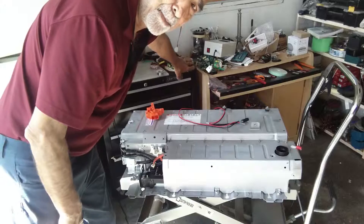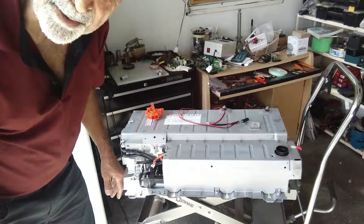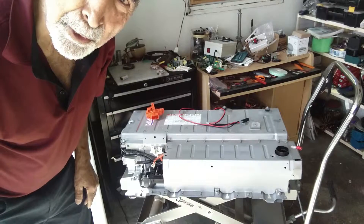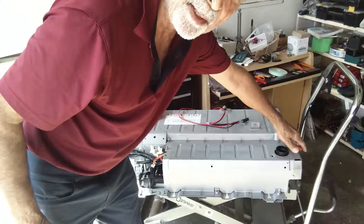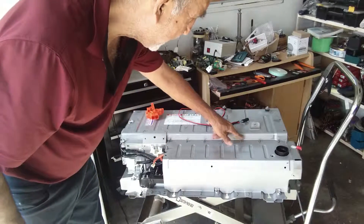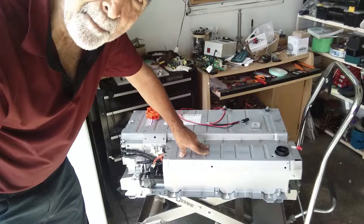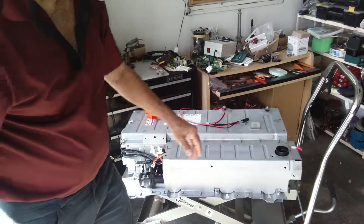On the other side, the back side is the trunk of the car. When you look at the battery inside the car, you're going to lower the back seats and you're going to see this part of the battery visible to you. Basically, you have to remove this cover and another cover here at the back. There are one, two, three, four, five, six, seven, eight, nine, ten, and eleven nuts for this cover to be removed, and then there are three nuts here at the back.